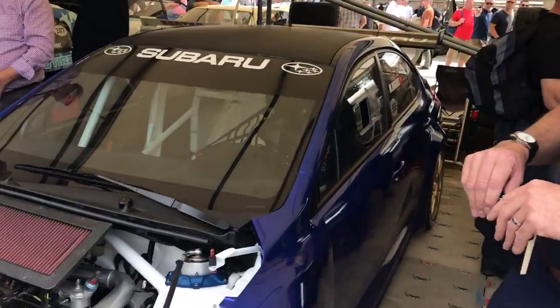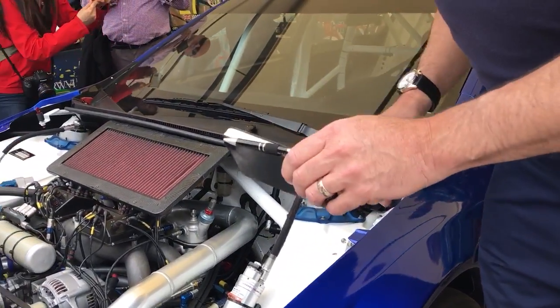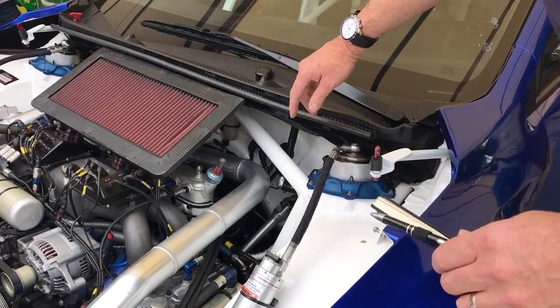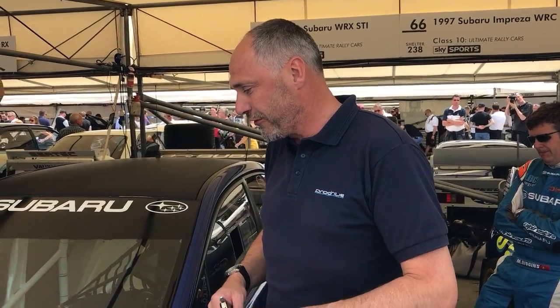You can see firstly the safety cage inside the car, all built to current FIA regulations. What's not so obvious are the subtle tubes coming through to the suspension pickup points and then down to the crossmember, and that really allows you to put some stiffness into the body shell. We've got something like 27,000 newtons per degree of stiffness in the body shell, compared to something like four or five thousand with a standard road car.